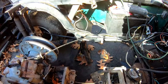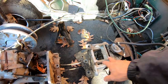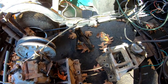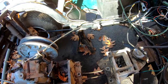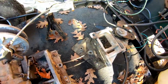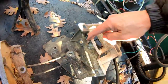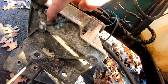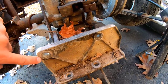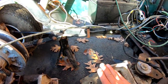I was hoping that it was just plug and play because I would use this bracket for the starter generator, and I wanted to try to use that. But if I remove that entire assembly to accommodate the engine, how am I gonna get the starter to work, you know? So what I'm kind of thinking is make some kind of bracket that goes up here, attached to these holes here that were supposed to be for the engine mounting for the original engine. It was mounted with side bolts too. Maybe make a bracket so that there's a flat plate right here.